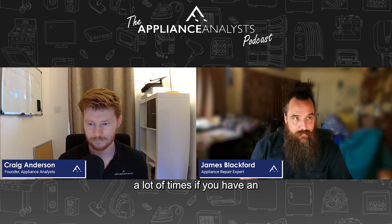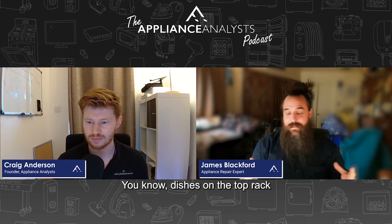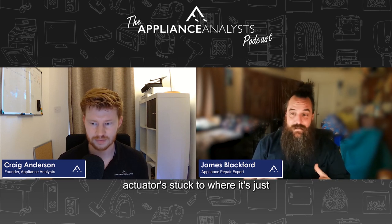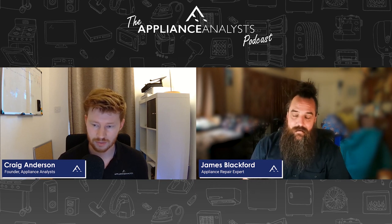A lot of times if you have an issue where only one of your racks is getting cleaned, like dishes on the top rack are great, but the bottom rack's not getting clean, maybe your actuator's stuck to where it's just not sending any water to the lower spray arm. Gotcha, right. Interesting one.